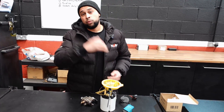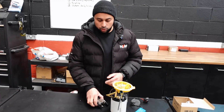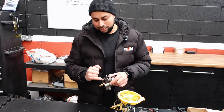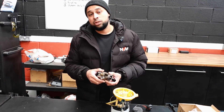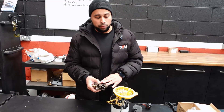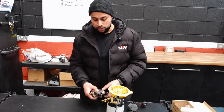At the same time, the actual fuel pressure did start to drop before the duty cycle maxed out. We had a look at the high pressure fuel pump and it seems like whoever fitted this over-tightened it and caused the seal to break within there. Bits of fuel are getting into the oil, so now we've got to drop the oil as well, replace the high pressure fuel pump with a brand new follower and seal and new internals, and change the oil on the vehicle.